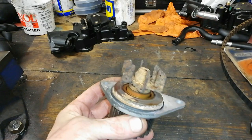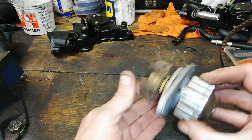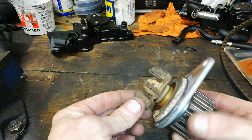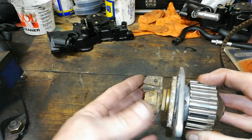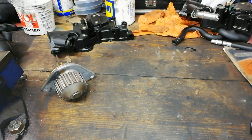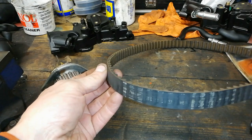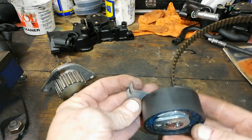You'd think that water pump had been at the bottom of the sea — it is spinning but it's very rough, like barnacles on it. That would have probably been cavitating, with a lot of air bubbles, and may have affected flow as well. There's about 138,000 miles on this car. The timing belt is pretty worn — you can hardly make out the writing on it. I don't know if it's original; he tells me another garage fitted a head gasket at some point.